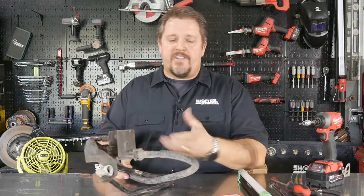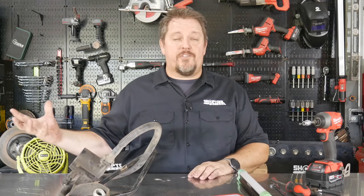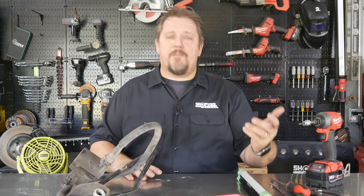And again, it's a solenoid valve that opens and closes, letting that tank breathe so that it's exhausting any of those harmful vapors, but filtering it through a larger charcoal filter. That canister's under there as well, but that's not the part we had to replace. Now, it's pretty easy to do. Without filming, I probably could have done this in 30 minutes, and with simple tools.